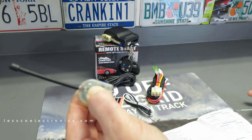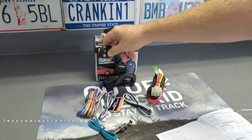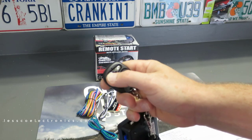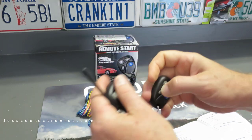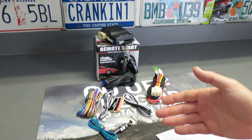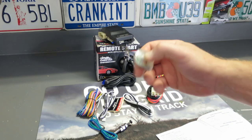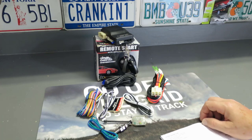Continue to hold the button until the parking lights flash and the horn honks, if the horn is connected. Continue to hold it until the parking lights turn off — you'll hear another horn honk, then release the button. You can learn up to four remote controls; it doesn't matter which button you use. I typically just use Lock — hit Lock and it'll confirm with a chirp and flash, then move to the next remote for the second, third, or fourth. You can wait 15 seconds for the system to time out, or just turn the key to the off position, and your transmitters are now programmed.